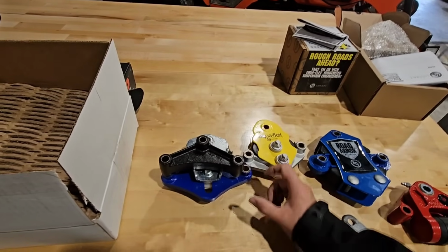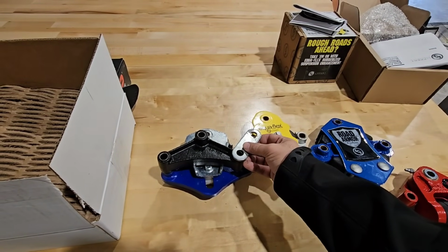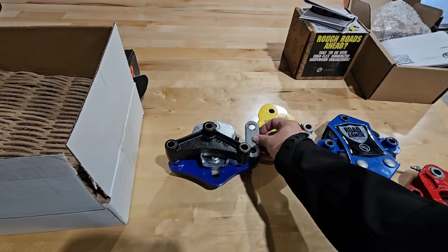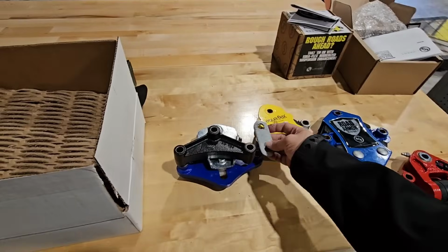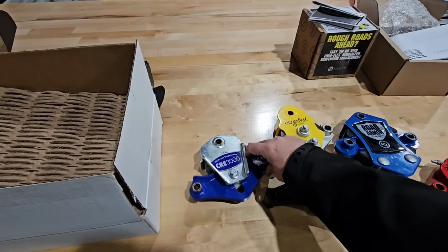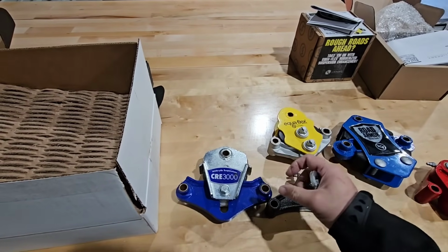Right now, the shackle straps are at about an angle like this. So if I put this on, they'll be going pretty much straight up and down, and that is not a good situation to be in because it's not going to properly space the axles, and at the same time, if this piece rocks whenever it's on its hanger, there's a likelihood that these will actually make contact with it, and that is not a good thing.